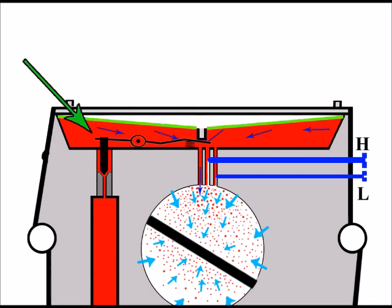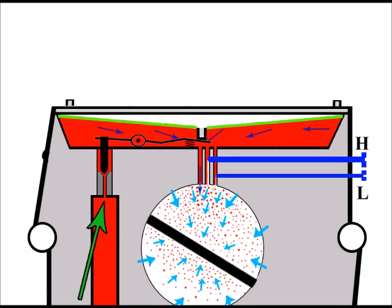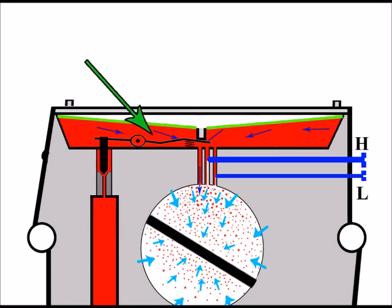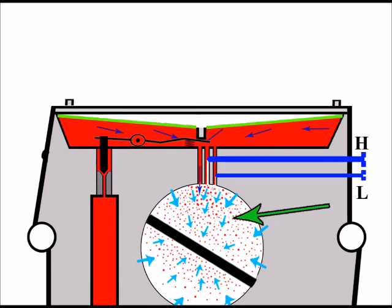So although the diaphragm's now correct and working perfectly, it can't possibly travel down far enough to lift the front there at the needle valve to allow fuel to come through. And the result again is this small gap, which won't allow enough fuel through for high engine revs. And although there's enough fuel available below here, it won't be able to come through that small gap quick enough to feed the top of the metering area here. And then of course, as we've already explained, there'll be less available for the main jet here. And then of course, in turn, there'll be less available for the engine.